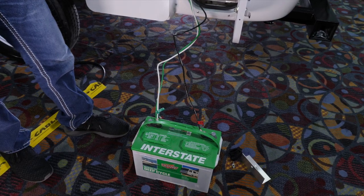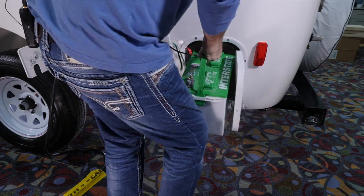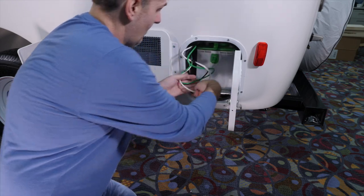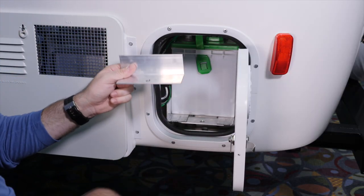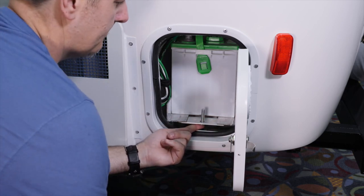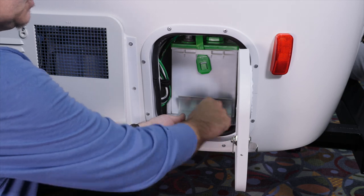To put the battery back, use two hands and lift it up onto the little metal tray, then push it all the way back in — it's important to get it fully seated. Put the velcro retainer back on the wires to secure the battery, then place the aluminum retainer bracket back on, insert the bolt, and wiggle it into place using two fingers from the bottom. Slide the aluminum bracket over the top of the bolt and secure it with the wing nut — hand tight is fine, just nice and snug.